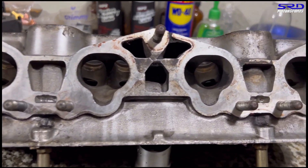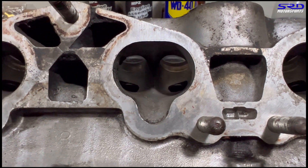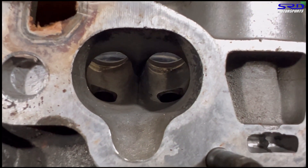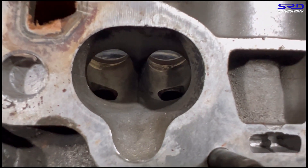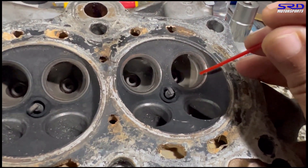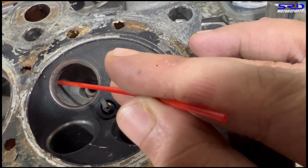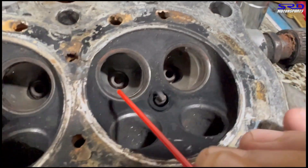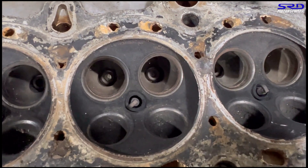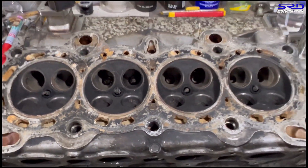Now let's look at the stock casting of the PM3 head. You can see the port shape is really good, but the core shift is significant. Right before the valve seat — before the throat, between the bowl and the throat — you can see the shape has moved a little bit to the left. On the bowl, the valve seat is aligned well to the valve guide, but the port itself has moved a little to the left. This left side is indented inward. If you clean that up, it goes way too wide. And on the other side, the wall is imposing on the way to the throat, covering it — being an obstruction. Every single port has different movement. So now let's start working on this and go straight to the porting bench.